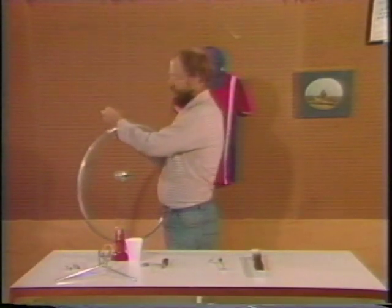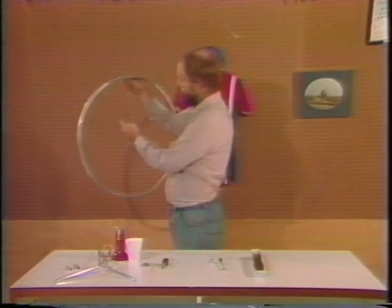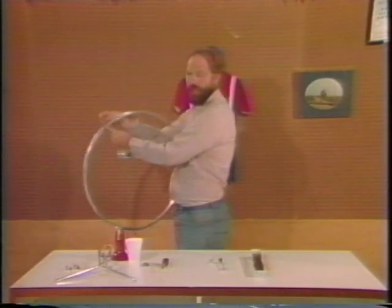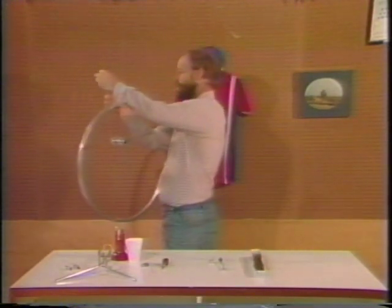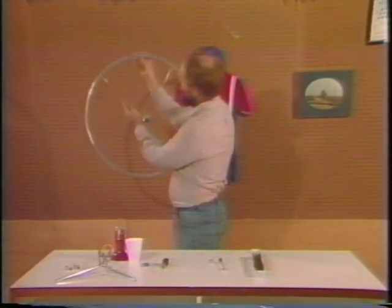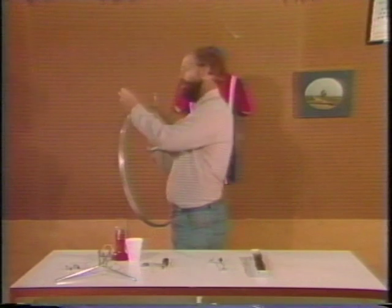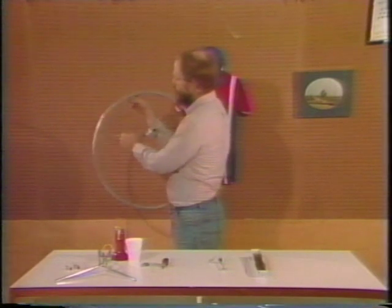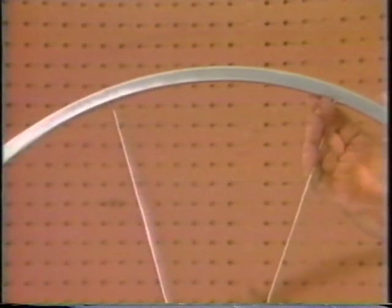The reason we're going to the fourth hole is, I mentioned earlier we have 4 sets of spokes, the sets being the head-in and head-out from each flange. So that means that you have 4 types of spokes and you need one hole in the pattern for each type. So you're going to put these spokes in each fourth hole. That means you're going to leave 3 empty holes between each spoke. So you work around the hub, picking the next counterclockwise spoke, and you work around the rim, in each case going to the fourth hole counterclockwise of the last spoke you inserted. All right, here we go all the way around.